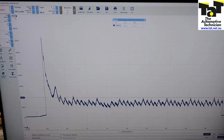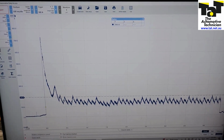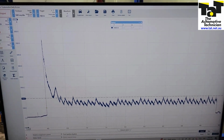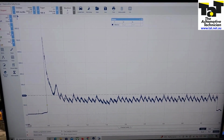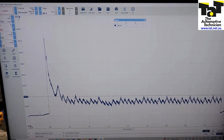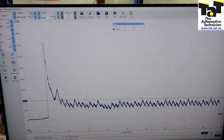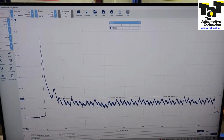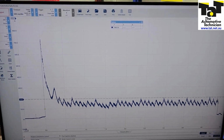And as you can see, obviously looking at the freeze frame data, that's why the freeze frame data is quite important, because we can see when that misfire or that code exactly was flagged and what the current conditions were. We see it was at idle, and all the fuel trims were good, MAP was good, so everything looked pretty good. So that's why we said, let's just jump on and do a relative compression test, and that was a great result. We can prove that there's an issue going on here mechanically.